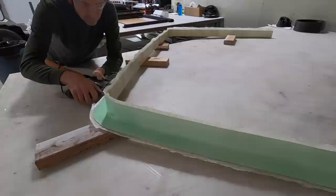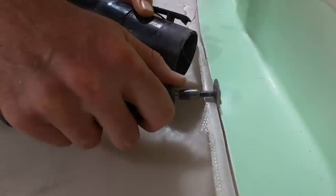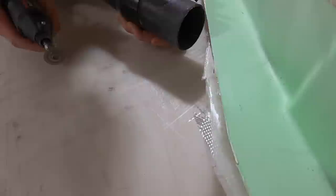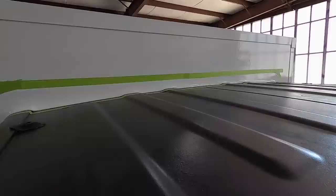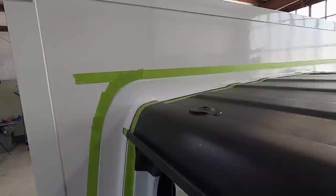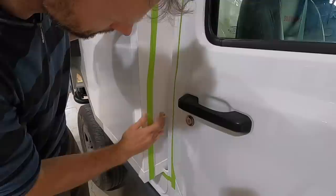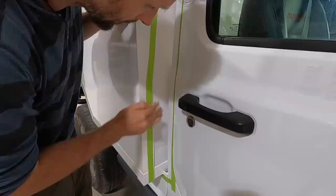Now that the B-pillar piece has cured for a couple of days, it's time to pop it off the mold and trim it to size. The green stuff on it is just mold release — Michael's leaving that on while we're working with it so we don't scratch or damage it. We needed to do a couple of test fits to make sure it goes on cleanly and sits exactly where we want it. Given that this was molded off Michael's Jeep, the fit is absolutely perfect — the level of detail on this custom molded fiberglass piece is incredible. Once Michael was happy with how it sat, it was time to prepare to bond it on, so the first thing was to mask up around all the edges where it was going to sit.